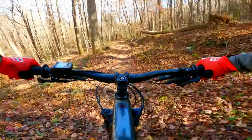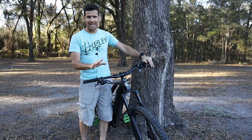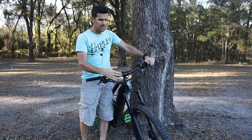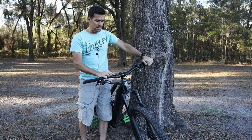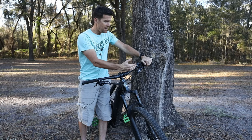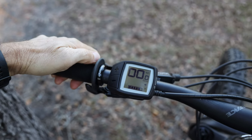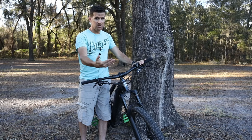When riding this bike, it's supposed to top out at 20 miles per hour. According to the speedometer, the motor will start to taper down at about 18 to 18.5 miles per hour, and once you hit 20 miles per hour you don't get any power from the motor — you're on your own. I did feel like the speedometer was off a little bit, almost like the wheel circumference wasn't programmed correctly into the head unit. Comparing to my Garmin GPS, the speedometer was reading about one to one and a half miles per hour too high. I looked online to see if I could adjust the wheel circumference in the Bosch head unit but couldn't figure it out — maybe that's by design so people don't make the bike exceed the 20 mph class one e-mountain bike limit.